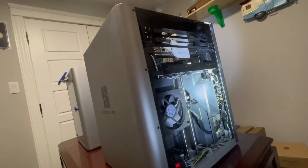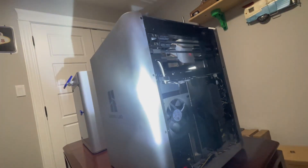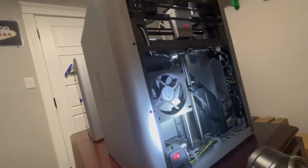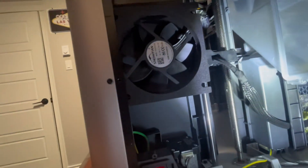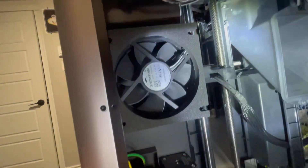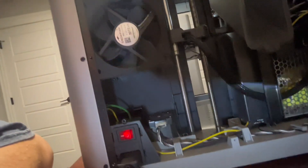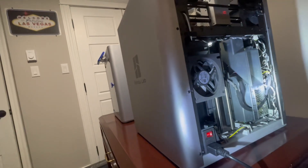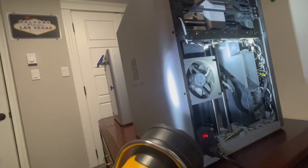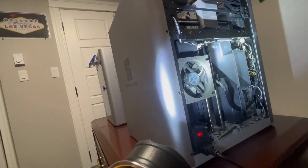So that fan — I noticed a noise in my printer. I took this out, the green one, just to prevent further issues, and I blew all the dust out of it. While I was doing it I realized I haven't been greasing this shaft right here. I've been greasing the one that lifts it up and down, but I haven't been greasing the one beside it — I didn't even know it was there. So I'm going to go ahead and clean this all up and put a little fresh grease on it.